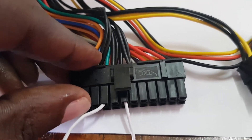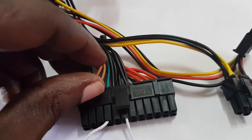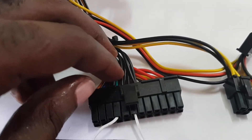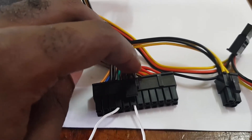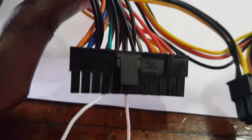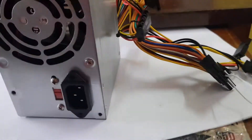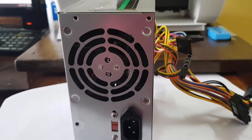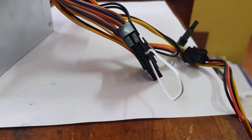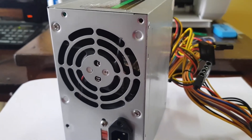It's not as hard as this — as soon as you have both hands free it's quite easy to do. Remember: connect the one green wire with any of the black wires using a paper clip. Once you're finished, it should look something just like this. Now all I gotta do is plug this in, and once I plug in the power supply, please remember never to touch the paper clip while it's plugged in, as there is electricity in it and it can be very dangerous.